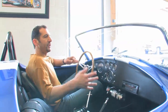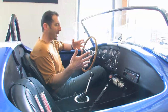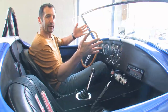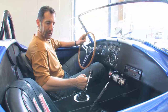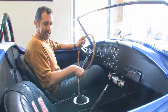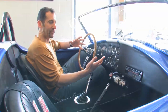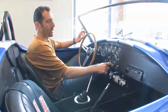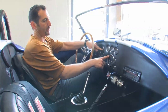This is interesting here. Because these cars started out as British sports cars, they only had a small four cylinder in them, which was like a tractor engine and tractor transmission. They were built by AC and were never intended to shove a honking seven liter V8 in them. Typically the shifters are right here, so if the shifter was right here when you went to go put it in second, here's what would happen. That's why they put these shifters forward, so that when you go to second, you're nowhere near. Got reverse lockout. These are Smith's gauges — the gauges that would have come originally on the cars. And this is a reverse counter speedometer, so that with the tach and the speedometer, the needles would be very close and you wouldn't have to take your eyes off of it.